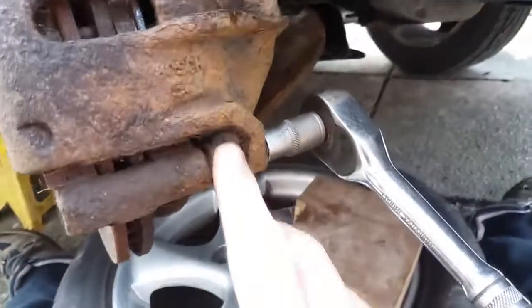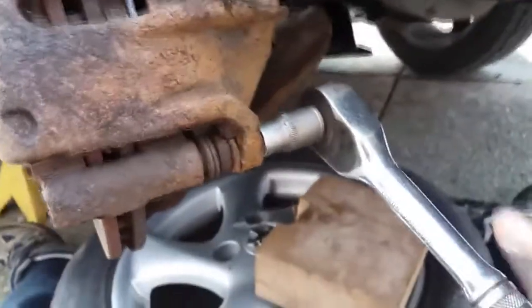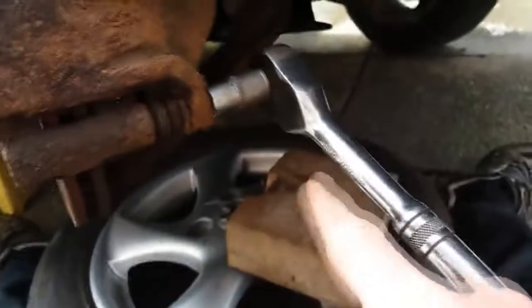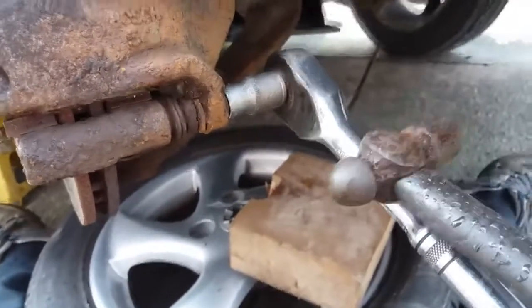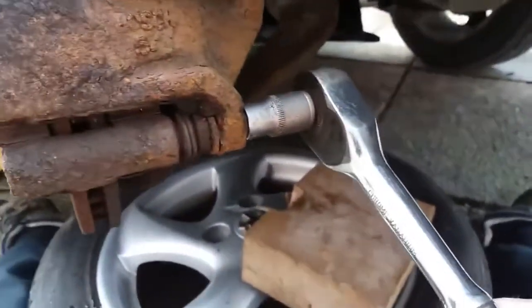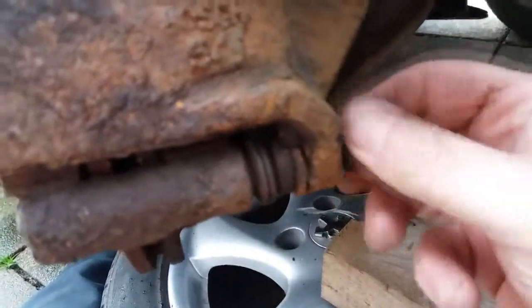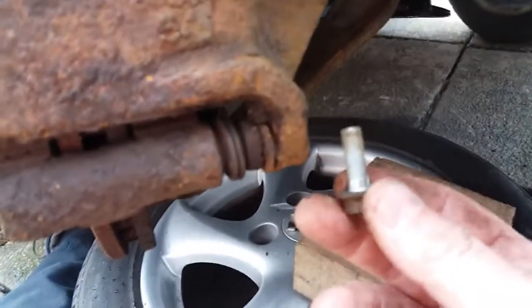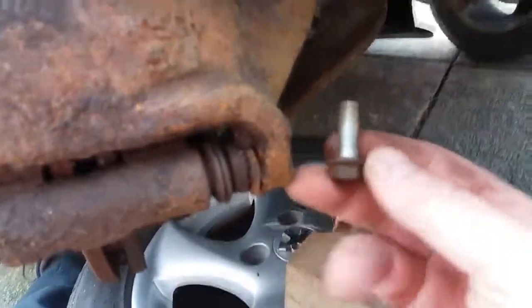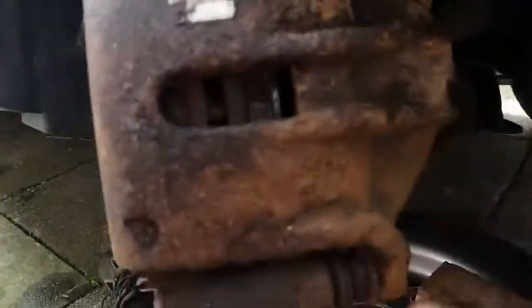What I'm going to do now is undo these two bolts. You can undo one and flip the caliper up. I'm using a socket to undo this caliper bolt. You might not have a socket - you might have a spanner. If you're using a spanner and it's a little bit tight, you can give it a little tap with a hammer, tapping downwards to undo the bolt, just to take that first bit of tightness off. Using a socket it should come up easier. When you get new brake pads, chances are you're going to get new bolts as well, which is good. I've pushed the piston back so everything's nice and loose - lift that up.